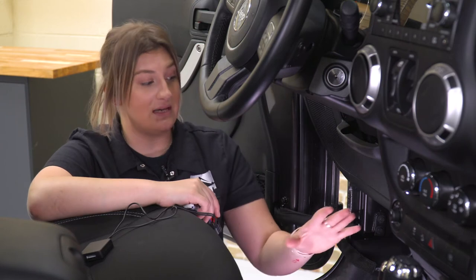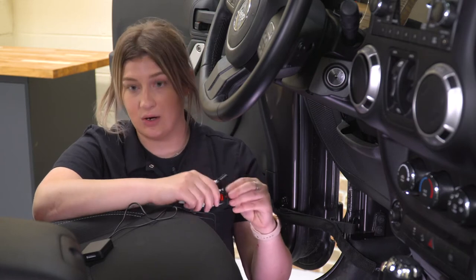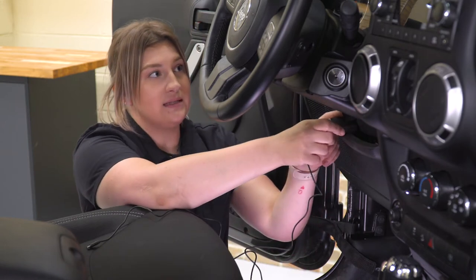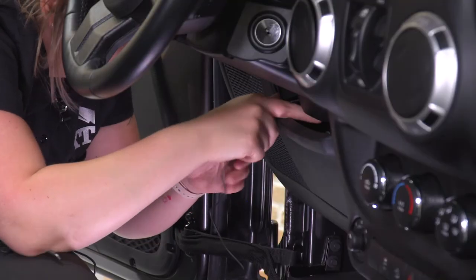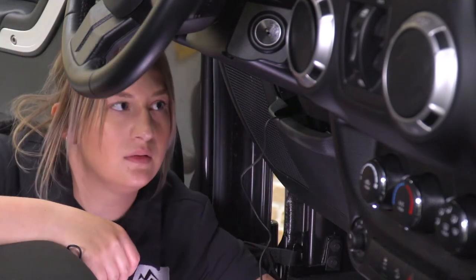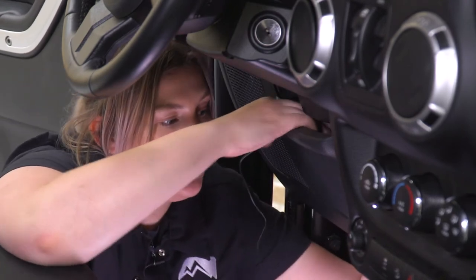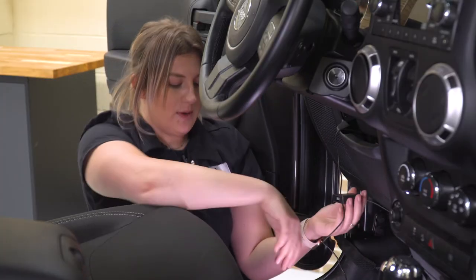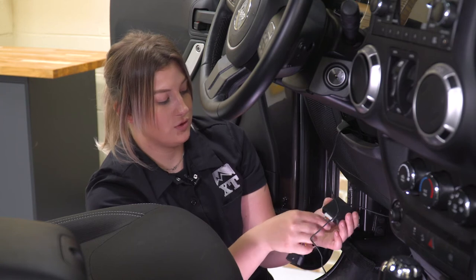It's going to be difficult to see because it is up inside the footwell, but if you follow the gas pedal all the way to the top, you will find the harness. First step, we're gonna take our control box and drop it down behind the steering wheel. Once you get it through, you can reach up underneath the dash and pull the control box all the way to the bottom. Then we can take our main plug and plug that into the control box.